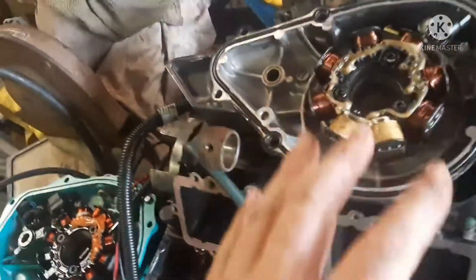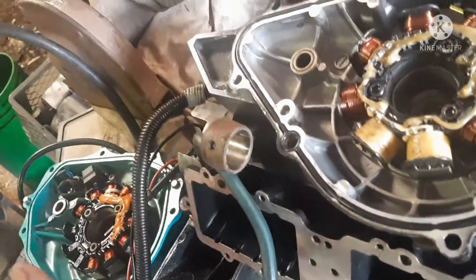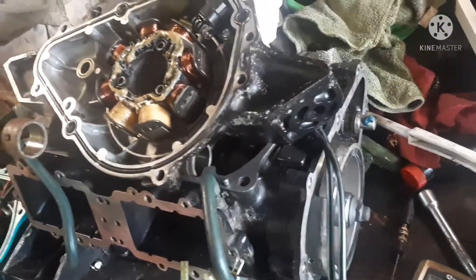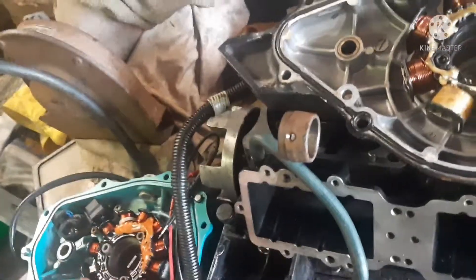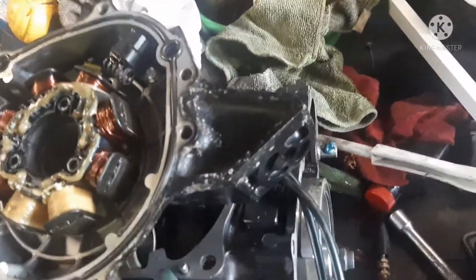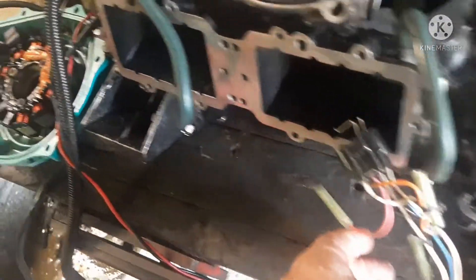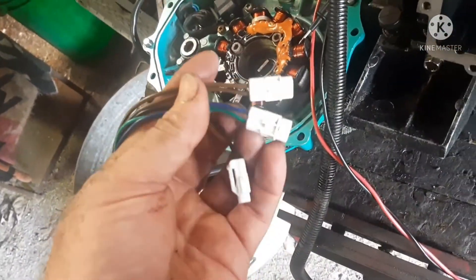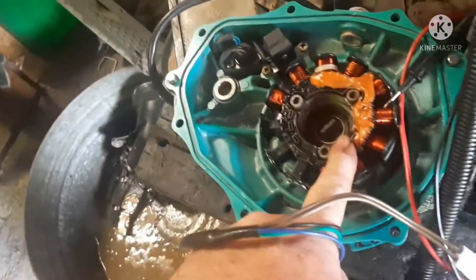You do not have to pull the stator out of your jet ski. This can be on your engine inside the ski; you just pull the wires up out of the electronic module. It's a little harder to do on the Yamaha because it's a sealed box — you've got two 12mm bolts to take off, open it up with all those little eights, and then you can get to the wiring. Yamaha sealed up all their wiring so water couldn't get to it. Kawasaki has plugs you can disconnect, available in the hull area toward the back, and you'd be checking the two browns for that same continuity.